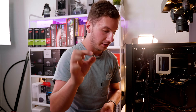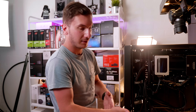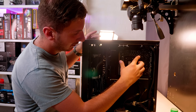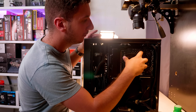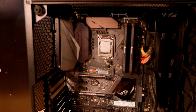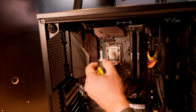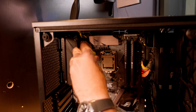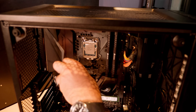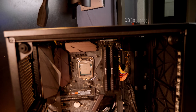You're gonna get the bracket and line the standoffs with the holes. The little standoff positions move, so they come out in four positions around the socket area. Then you install your standoffs into those four holes using a screwdriver. No particular order is required — as long as the clamping pressure is there, your CPU won't explode. And that is your mounting bracket on.